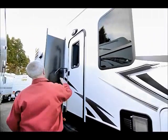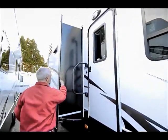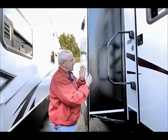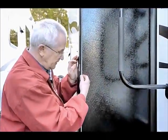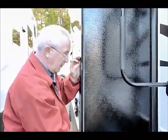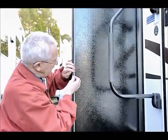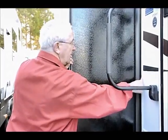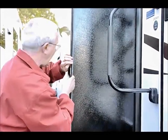On this side we have the slide-out. One nice thing about them is they use these — I call them wiper blades — and they're not glued in. So if we need to replace these, we just take out a screw here and a screw at the top, pull them out. Like a wiper blade, you just put in a brand new set and away you go. Notice how this is gray too, so when it's resting against the molding it's not going to leave a black mark.